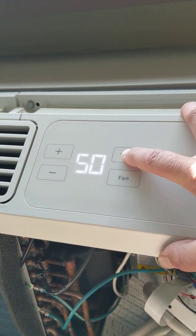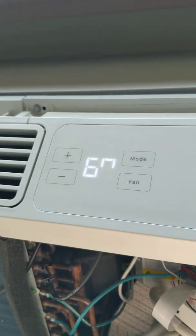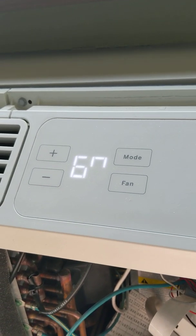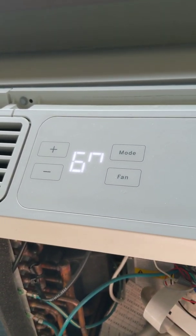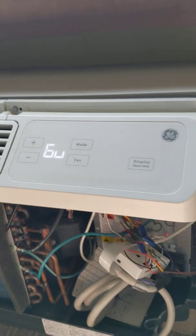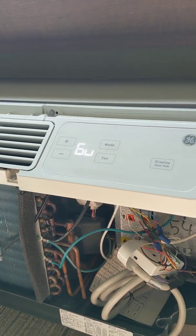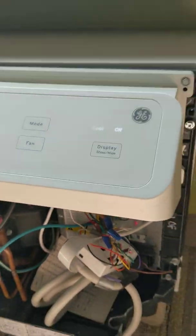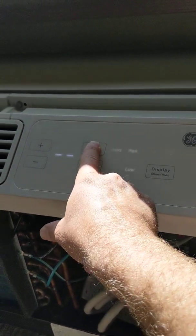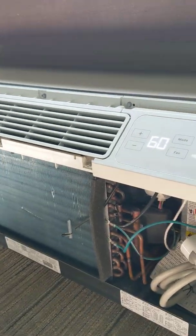To disconnect the Verdant wall thermostat, you have to hit mode again and again. Now if the thermostat was connected — like it was just a few minutes ago before I worked on this — it would say 6 with what I call an N, like an upside-down U at the top. That basically means the GE Zone Line is being controlled by the wall unit. All you have to do is hit the minus button and put it to 6U. That's it — that makes this unit independent. There are some ways hotels can get around that, but generally this does work. Now you have total control on this unit. The only other thing you have to do is go back down and hit AUX to save it. Then the unit shuts off, and you hit mode and go back to heating or cooling — whatever you're going to do — and I've got it set at 60.